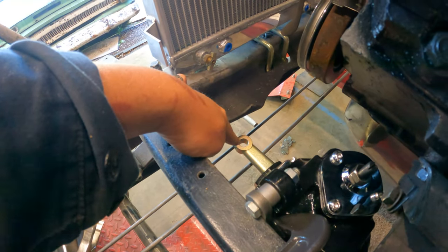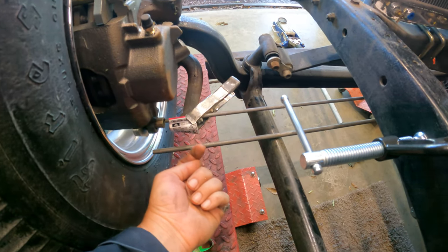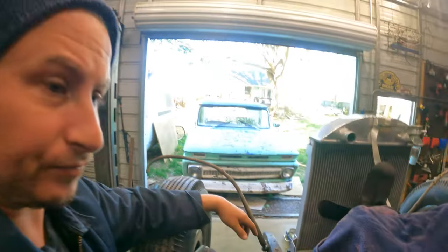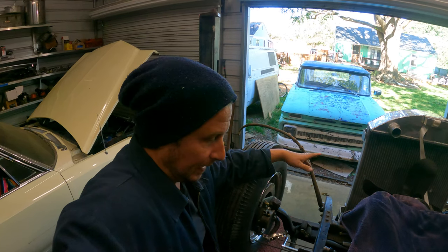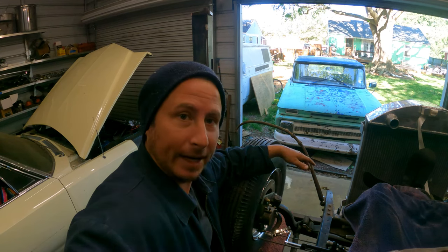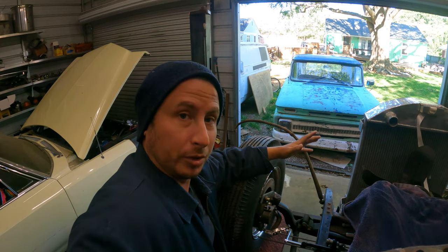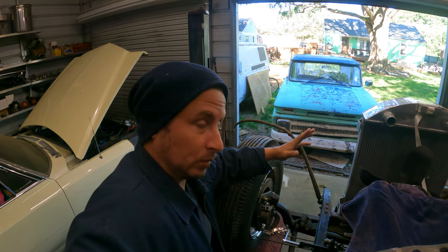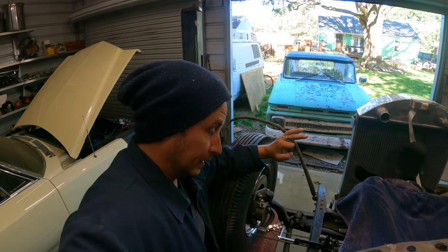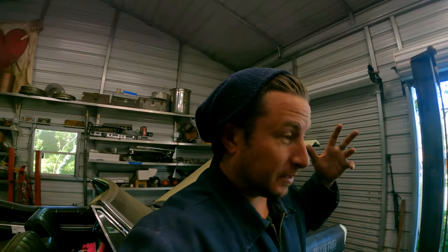Obviously, this will need to kind of cruise down a little bit anyway. We'll need to be able to get a tie rod up under the far side. I'm just using this for an example, which means that has to come down. So it's just fitment issues. There are several ways to solve the problem, and I think the reality is it's gonna take a combination of everything, but no matter what, we're too far forward. Up and down we can deal with, but if moving the whole box down to get us further back is our starting point, that's where we're gonna start. So let's start there.